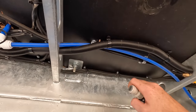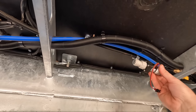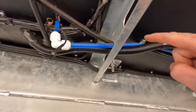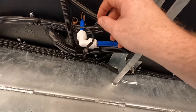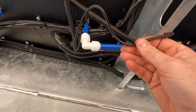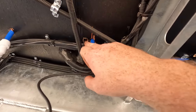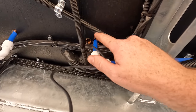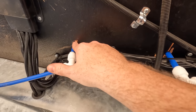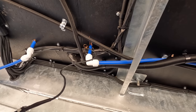I've just taken a couple of P-clips off to get access to it. I'm gonna cut this thing in, P-clip and zip tie it all up so it's nice and neat. And then I'll run my cable from here up through this penetration I've just done. You can see I've got the lead poking out now, so I can pull that to the length I need and then tidy it up. When I'm finished, I'm gonna seal that penetration that I've made, and I'll also seal these other penetrations from factory that appear to never have been sealed. I'd like to see any hole in the floor sealed.